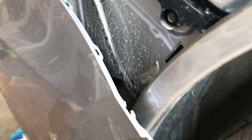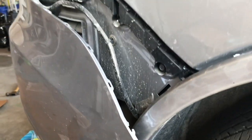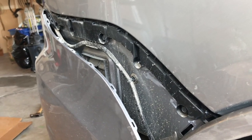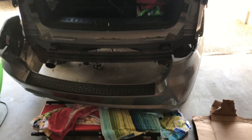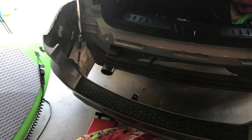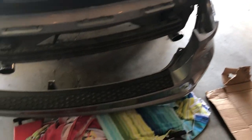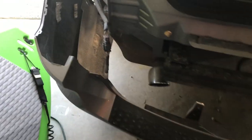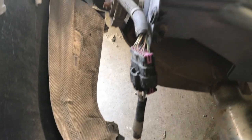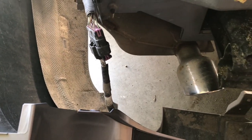There's another video that shows how to do this which I'll link below. It's going to be hard for me to hold the camera and do this at the same time, so just go careful. Another piece of advice is to actually have something underneath the bumper when you pull it off, because as I did — as soon as the clips came out, it fell. The last thing we need to do is disconnect the rear sensors so that we can take the bumper fully off.